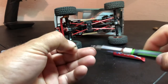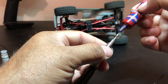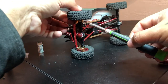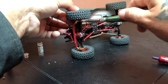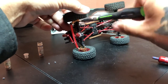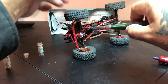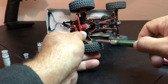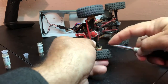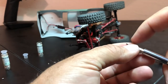Let's get this one back together. The one that is still good — I'm running machined aluminum axles so I Loctite everything. You know what I found works best when putting Loctite on your knuckles: put a drop of Loctite on the knuckle itself and then wipe the knuckle clean, so the screw will go down into the threads with Loctite but the Loctite won't be on the part that needs to swivel, so you'll have better steering action.